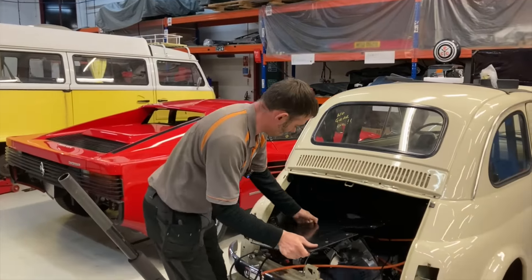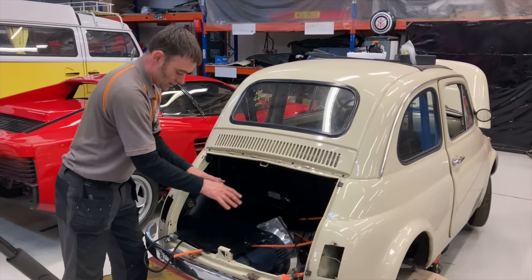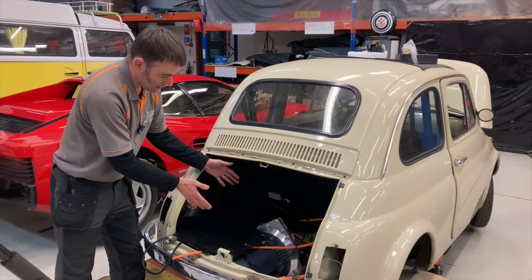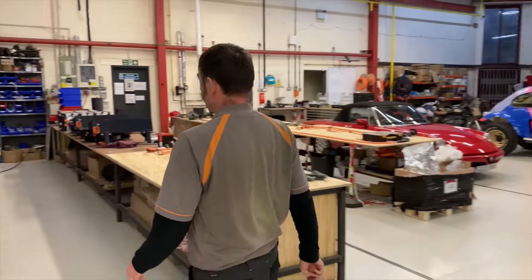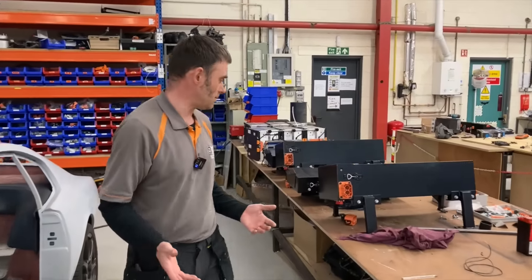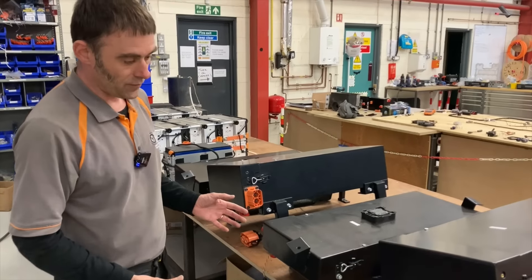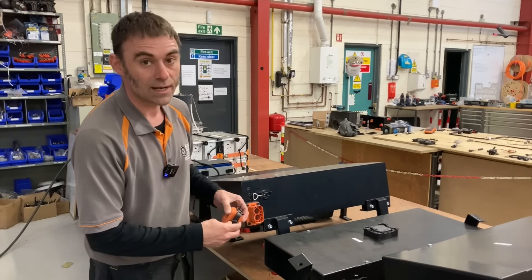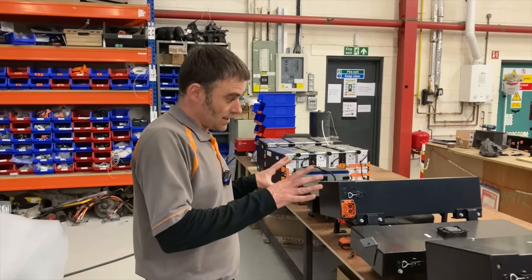Then you've got two plates that go on here, sitting in like that on each side. These are fairly thick alloy, and on top of that you've got all the mounting holes for the battery boxes, motor controllers, and high voltage junction box. We've got two Fiat 500s getting converted at the same time. So these are the battery boxes: that's the rear one, that's the front one. These are all done, finished, with the high voltage already on there — including the isolator, which is your service disconnect, plus the high and low voltage plugs.